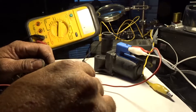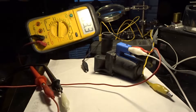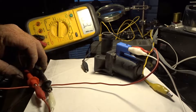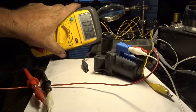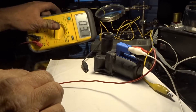There could be a diode in there. I don't know why, but for a regular on-off coil, there could be a diode in there just to stop the voltage from going back into the PCM during the magnetic field collapse. Reading it again, it's about 3.2, 3.1 ohms right there.